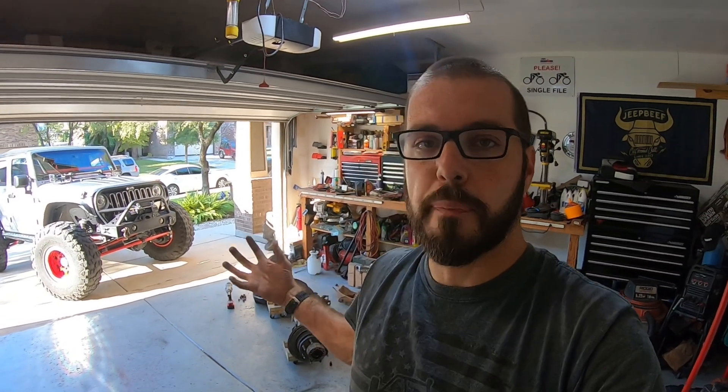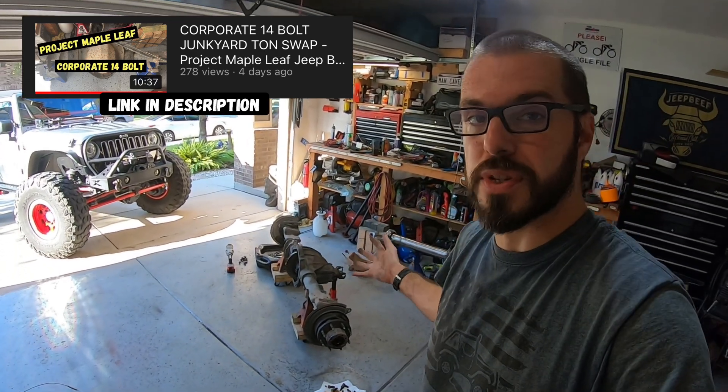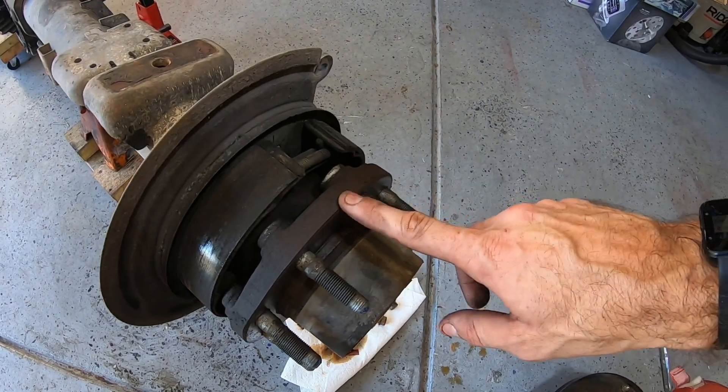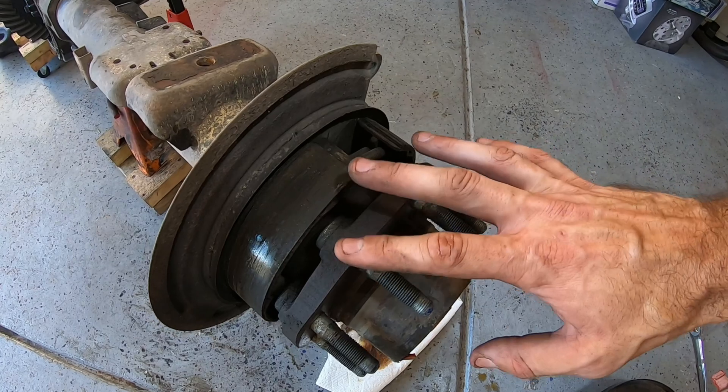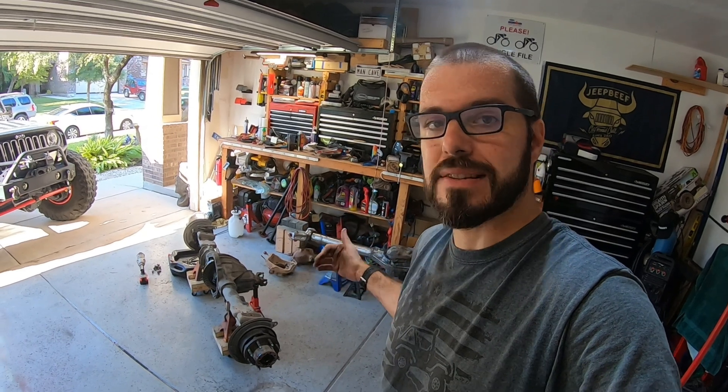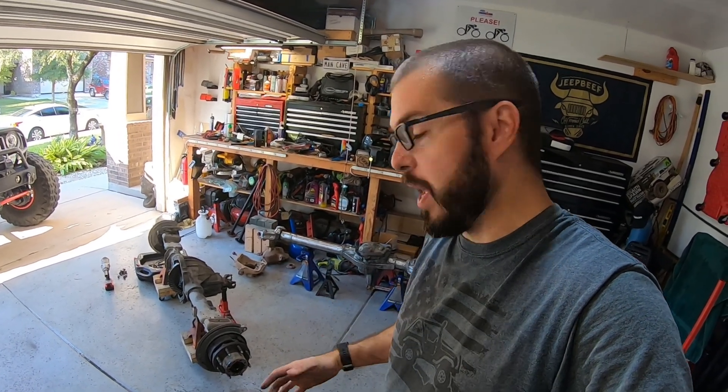That was a perfect opportunity to pull those axle shafts and give them an inspection. They're big — that's the reason we chose to use this axle. But you don't know the history of your axle, so it's worth giving them a quick inspection and making sure the splines aren't twisted. The hub bearing on this side is greasy and nasty because the seal in that hub bearing is starting to fail. If you wind up having a diff fluid leak on the inside of your rear wheel but where the axle shaft sits on the end is dry, that's going to be that seal — which is pretty easy to gain access to.